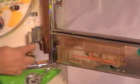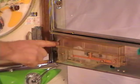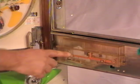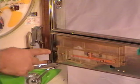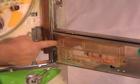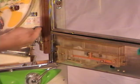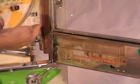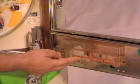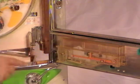So what would happen is there's this metal weighted part here. That part would weigh down on a piece of plastic which would engage with this one here. So for anyone else watching this video, this weight here would go over that plastic arm sticking out, actually over here. Okay, now when you shut the door, you'll want to lift up on this part here. Lift and hold it up, and then close your play field door, play tray door. That way this part is above the part on the door.